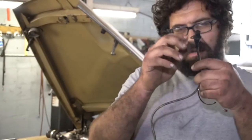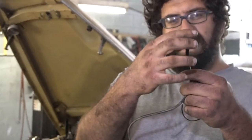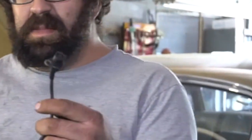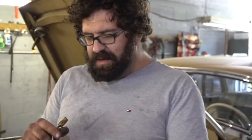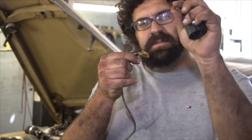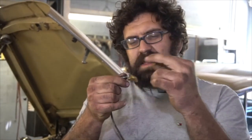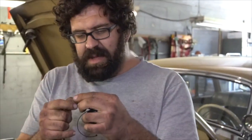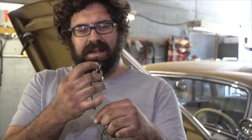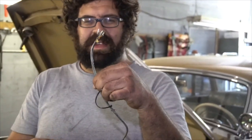This sensor is totally wiped out because, as you can see, there are copper windings here, and the magnetic base has just been destroyed by grease and dirt — engine grease and dirt wiping it out. It came from a 210,000 mile 300SD. This plug also shouldn't be discounted; it's made of the same plasticky material as the vacuum lock system plugs, and as you can see, it wears away until all you've got are three pins left.